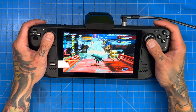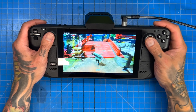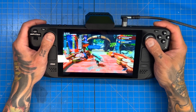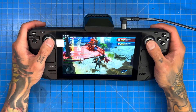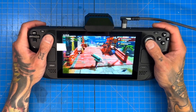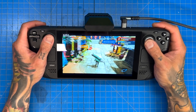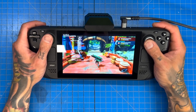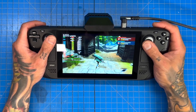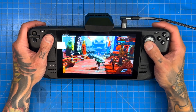54-53-55. Definitely a lot better — it's about a 10% increase in performance. But look at our temperatures: we're peaking at 85°C at moments. It's running very, very hot now, and we're only at a 20-watt TDP, which is crazy. A stock Steam Deck in this room climate could not even hold a 20-watt TDP — you'd have to bring it down to maybe 18 watts.